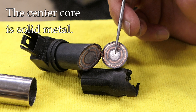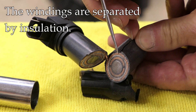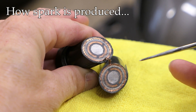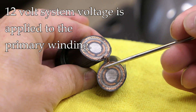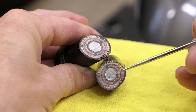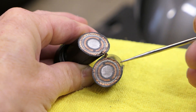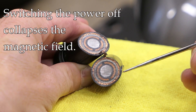The secondary winding is going to be a finer wire with more tightly wound coils. And then in the middle of all that is the core. There's not a lot of insulation or space between the primary winding and the outside of this — in fact, there's a piece of plastic peeling off. So here's the way these coils produce a spark for the spark plug: it basically uses electromagnetic induction. What we do is apply 12 volts, or the system voltage, to the primary winding — that's the one on the outside. And when you apply a voltage to a winding like that, you also create a magnetic field, and this core, which I think is iron, helps concentrate that magnetism.